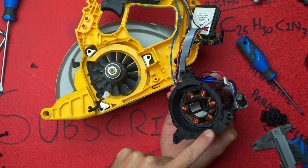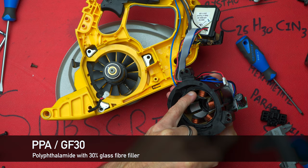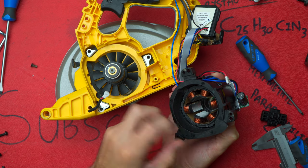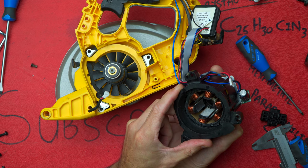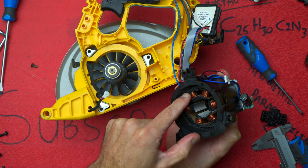Also having a look at the material: I guessed it was going to be a polycarbonate, but in fact it's a PPA — so it's a type of nylon, glass fiber reinforced 30 percent as well. You can feel it, it's a very very hard plastic. Not too bad — two fasteners in there to remove the actual motor from the casing itself.